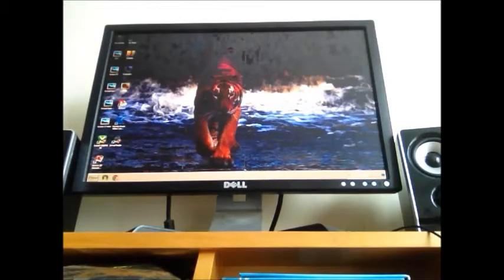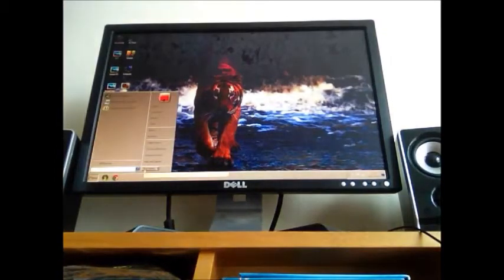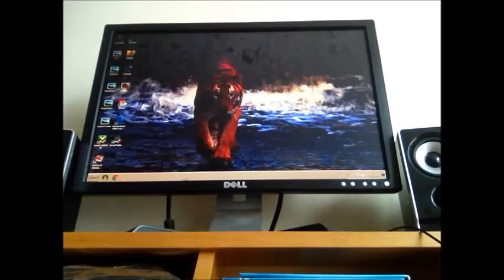Quick summary was, so first thing we did was get a sound card and open the tower of the computer. And so sorry, I was just over there. Okay, so I'll start again. We opened the tower of the computer. We got a sound card, found the PCI port, and we put it in there. And then we closed everything back up, obviously securing the PCI sound card in place.